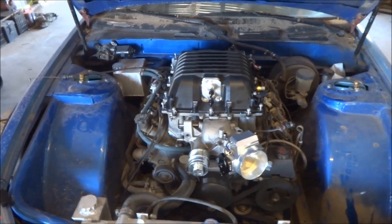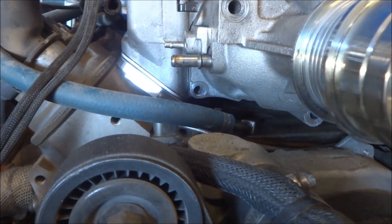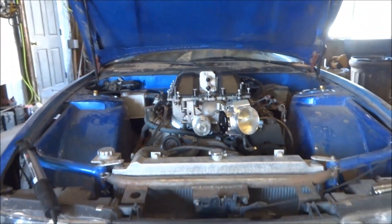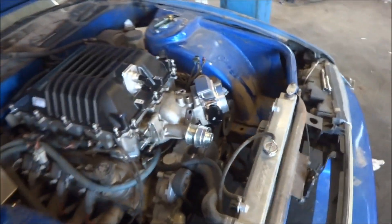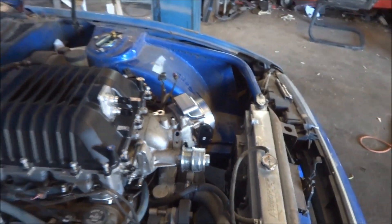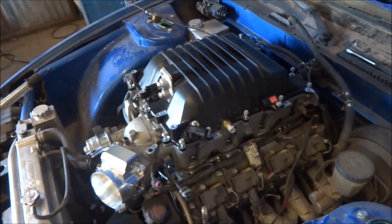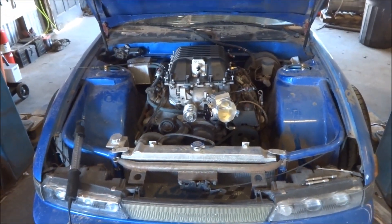I got the supercharger on there with the lid and the spacer. You can see the positive crankcase valve — it clears the supercharger with the spacer and the lid on. It's actually a lot taller than I anticipated, so it's not going to clear my hood. The pulley does line up with the belt supplied by Olsen Custom Works, but I just wanted to test fit to see where I could put my fuel regulator and lines. Hood clearance is definitely going to be an issue on this car, so I'll try to sort that out.